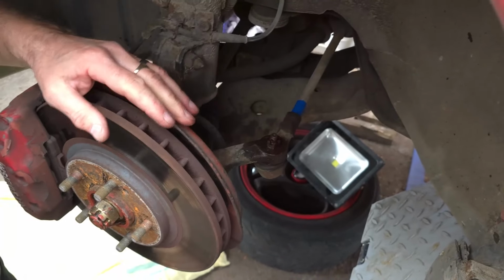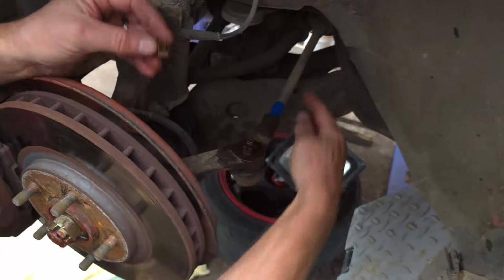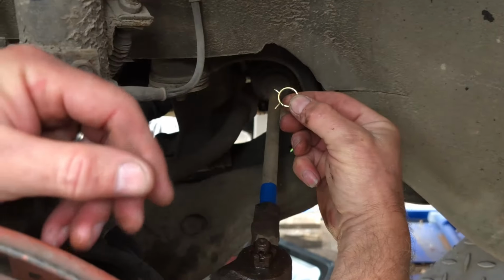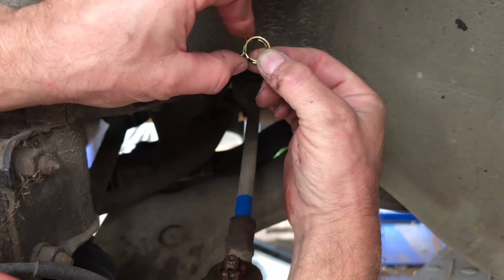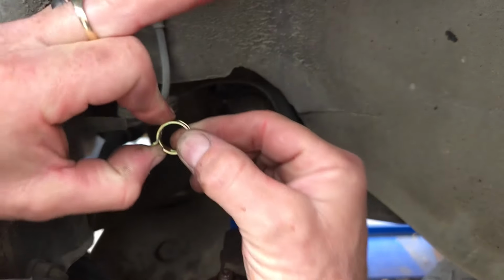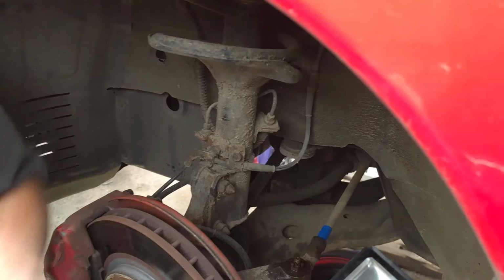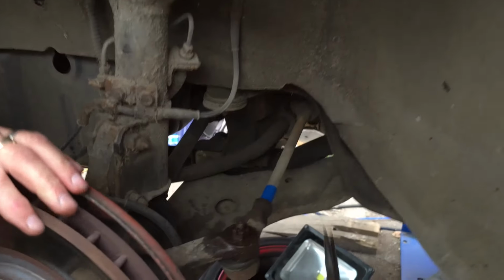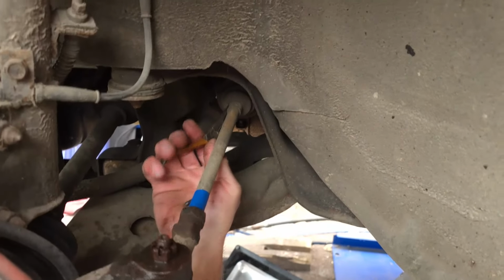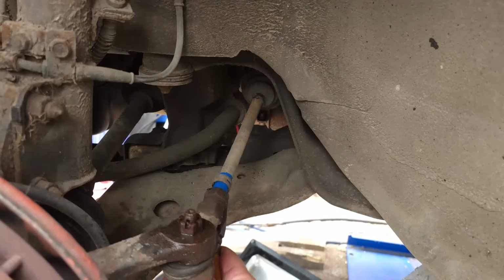Okay, next thing. Just give me 1 second. I brought one here. So on the end of the rubber gator here, we've got one of these clips. And to open the clips, you've just got to pinch the pins together. When you've pinched them together, it will slide off. So I only tell you that in advance so you know what I'm going to do in that tight space. Now sometimes a pair of long nose pliers works, sometimes a pair of regular pliers. Ah, that's good, that comes straight off, nice and easy.